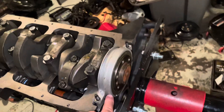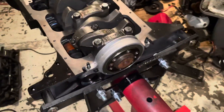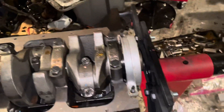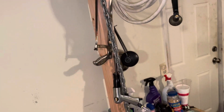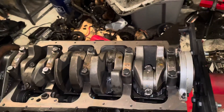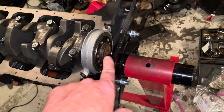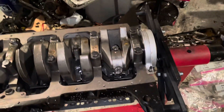I bolted it up — there are four bolts in the back and they take 135 inch-pounds to seal it up. I didn't show that part of the video. To get that rear main seal on, I had to take the engine off the engine stand. I keep a clean chain hanging on a nail, and I use a come-along to lift the engine, pull the back of the engine stand bracket off, put the seal on, and put it all back together. There's no other way to get this seal in unless you take that bracket off. Now it's back on the stand.